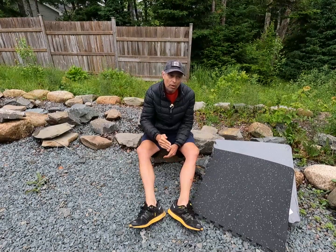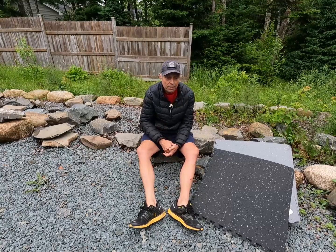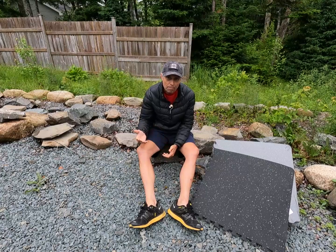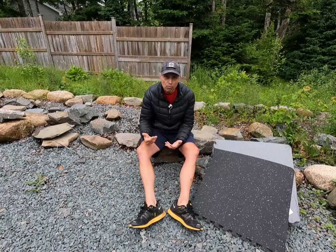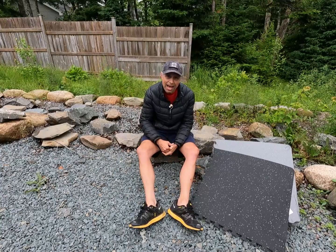And the reason why I'm not going with that method is, first of all, as most van dwellers are aware, a fair amount of condensation collects throughout time in your van from different sources, whether it be your heating sources or simply just by residing in there from your breathing. And that condensation then usually transfers onto your flooring and your subfloor. And what ends up happening is your subfloor gets a fair amount of rot. And that then requires you to remove the flooring and reinstall a new one, and that is just not something I want to deal with.